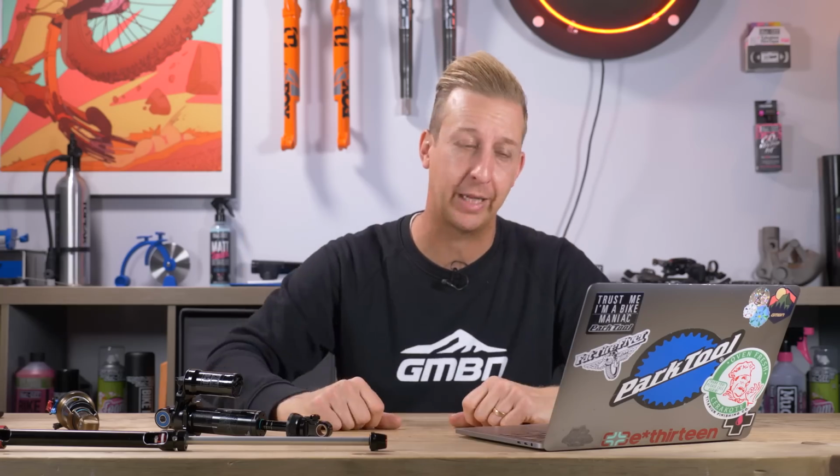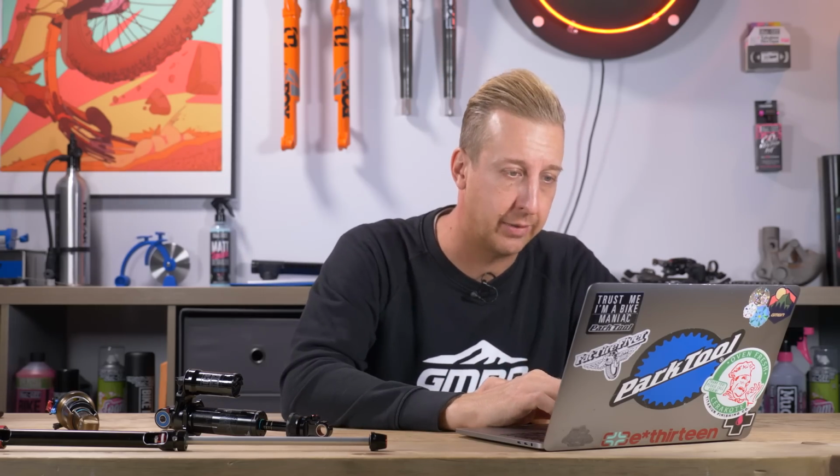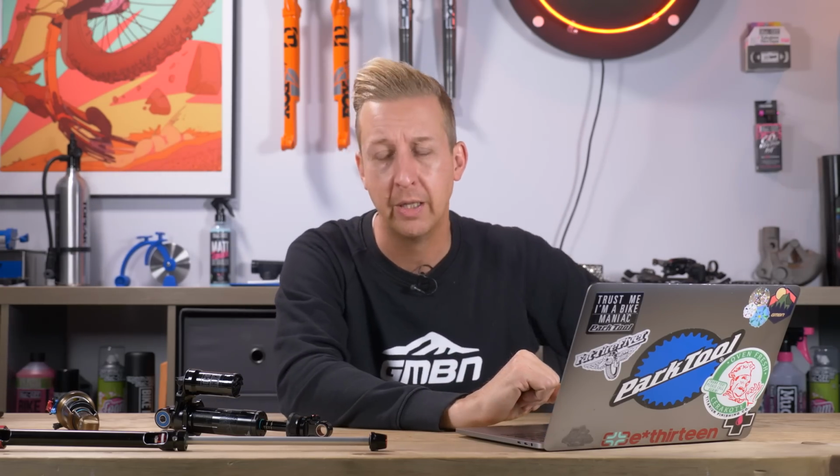I like the air shock, and nice and light as well. They're also very practical, because a bike manufacturer can spec an air shock and that's it. It can go in the shop and it will suit the person that rides it. Whereas a coil shock, they're going to have to ship it with a couple of springs, or the bike shop's going to have to take care of that. So there's more admin on that front.